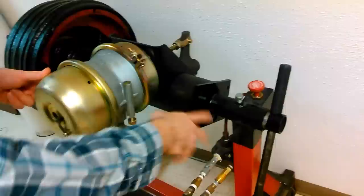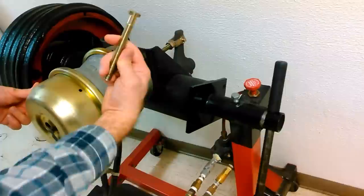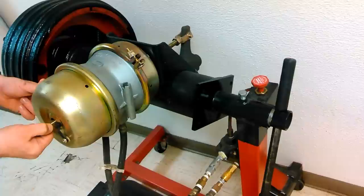When you're caging a brake chamber, you're going to chock the wheels, you're going to release the brake, you're going to take this tool out with the T on it, put it in this end here and turn it until it catches. It went in, and it catches and you pull out — it won't pull out now because you turned it clockwise.